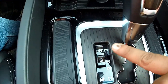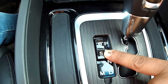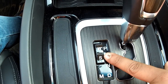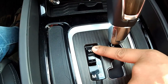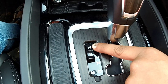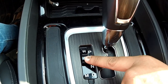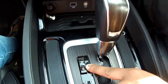We have two options: W and S. Everyone thinks W stands for winter and S stands for summer, but that's not correct. W stands for winter and S stands for standard. In standard mode, the car will always start in first gear. When you start the car in winter mode, the car will always start in second gear, because in first gear torque is full and the car can slip or skid. So in snow areas, the car should always be in winter mode, and in other areas, standard mode is used.